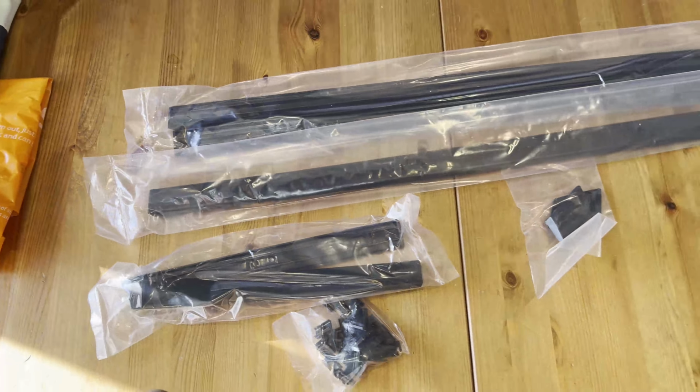I'm gonna take the headlight surrounds up because they're quite grey, which I'll show you in a minute. And I've got some trim dye. It's a bit like back to black, but it's a lot more permanent. Rather than heating them up, which a lot of people do with a blowtorch, it brings the oil out, but then the problem is they dry out again and go brittle. So I'm gonna try and not do that and just dye them back to black, and hopefully that'll last a lot longer as well.